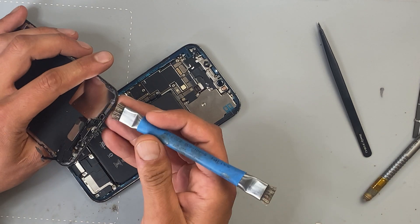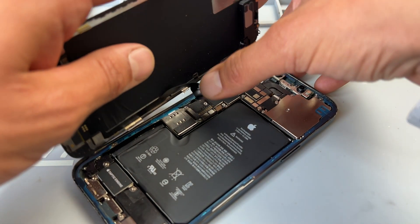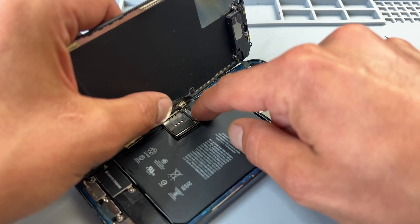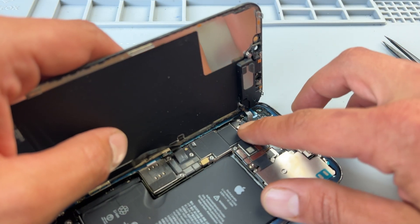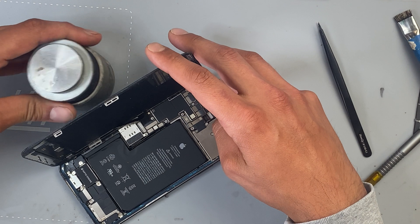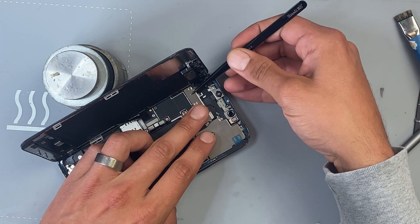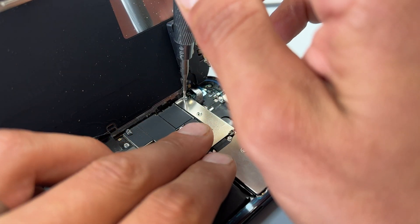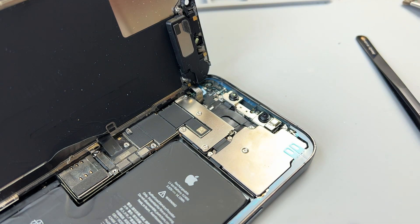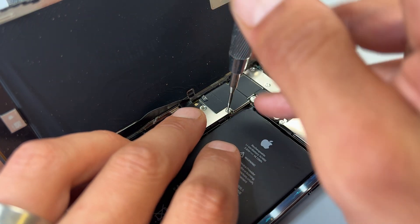This phone was particularly dusty so I'm just going to brush up the edge of the screen before I install it. To reinstall the screen I will start by lining up the touch and OLED connector and applying pressure, followed by the ear speaker flex and finally the battery connector. I'll place the heavy object at the back to stop the screen falling over, then install the big shield at the top of the device followed by the four tri-wing screws. Next we can install the shield for the screen flexors and battery — again four tri-wing screws hold this one down.